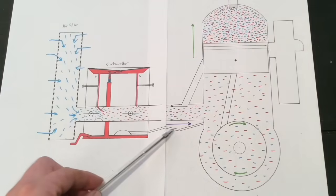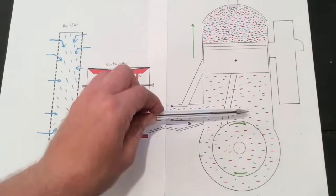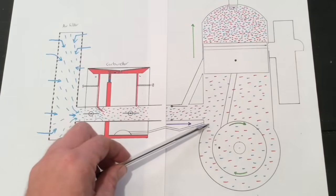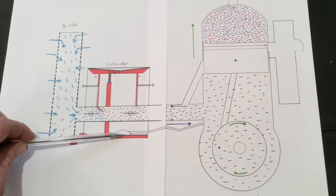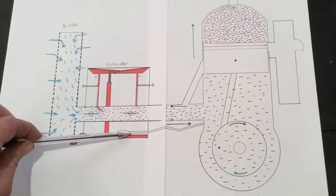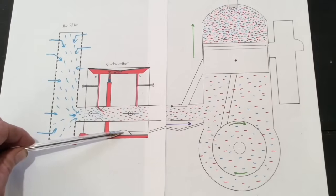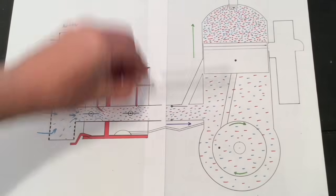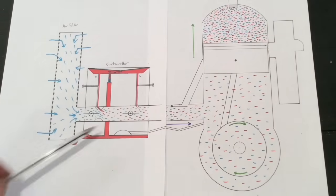We've heard of a pulse line. What that pulse line actually does is feed positive and negative pressure. So when the piston goes up, there's a suction felt there through this line, and it sucks on the fuel pump diaphragm and pulls it into this recess. And when the piston comes down, there's a positive pressure blowing — it blows the fuel pump diaphragm the other way. So as the piston works up and down, this works up and down with it, and that's what creates the pumping effect.